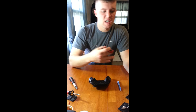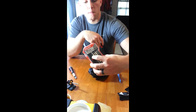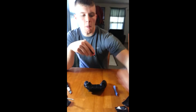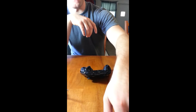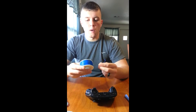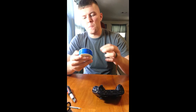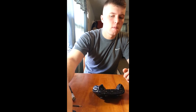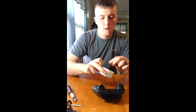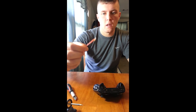There are smaller T6 bits inside the actual controller, so you can get a nice little kit like this. A pair of tweezers are helpful for putting the screws back into the holes. You're going to need what they call wrapping wire — it's just real small gauge. This one is 30 gauge, and that's going to be what you use to wire the buttons to the back of the controller. You need a soldering iron — 30 watts is fine. You don't need it, but flux is definitely helpful, and something to apply it with; I just use Q-tips.